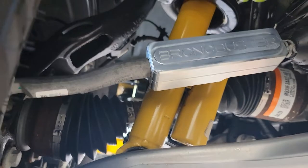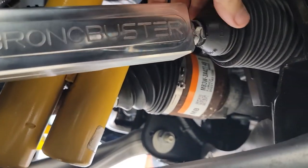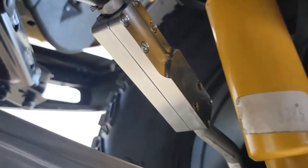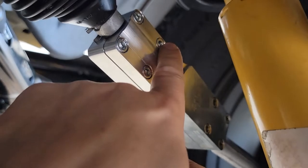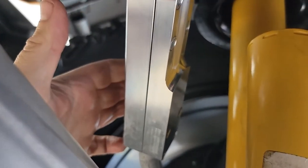I've tightened those up on the backside. Now I'm going to take my clamp — I rotated this up out of the way to put that on. This just rotates — it's moving at this joint over here. So now I'm going to take this and put this clamp back, up tight against the Bronc Buster brace. Loosen this clamp, slide this in, release the clamp and it's done. What takes the most time is just snugging all these up — it kind of reminds me of tightening up a triple clamp on a motorcycle. Just go back and forth, over here and over there — finger tight first, then snug them up with a wrench. He said it's normal to have a little bit of a split in here — that's the way they're supposed to be.